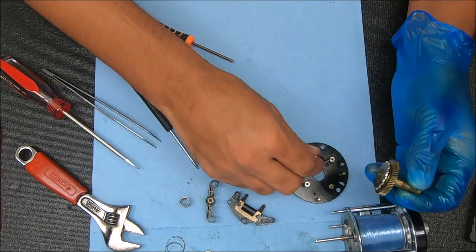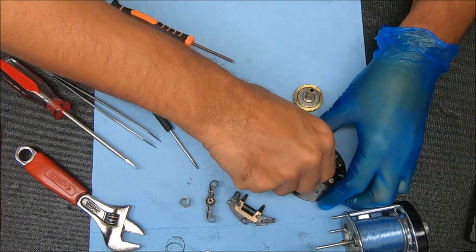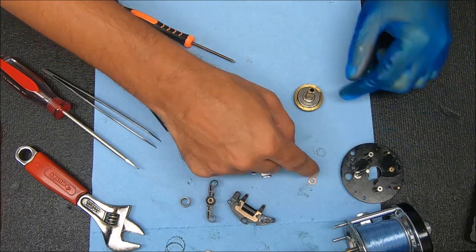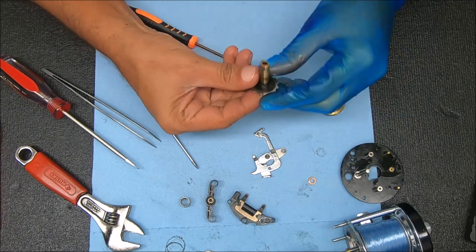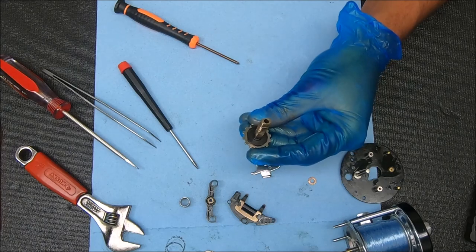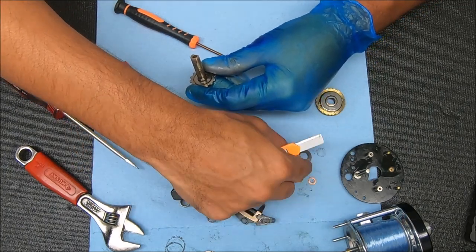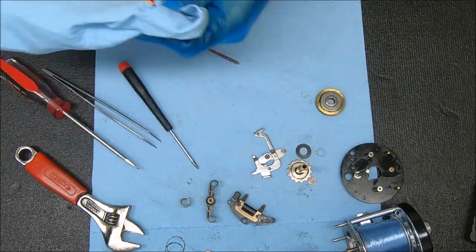Here's what I want to look at - under here there's a washer. This is the drag stack I want to look at. That's the bottom piece. You'll have a washer under here and I can see already there's a lot of oil deposits. We want some lubrication there but not too much, because when that happens it just causes it to slide more than stick.